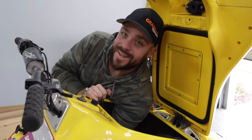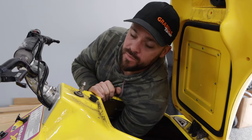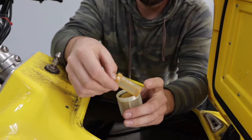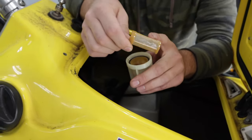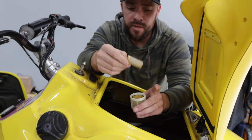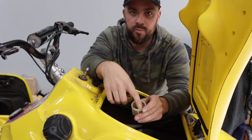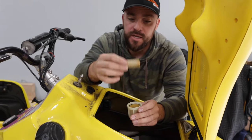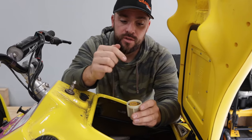We'll cover the last fuel-related maintenance item. You should be doing this every time before you put the ski away. Up front, directly underneath, there is a fuel filter. You can see there are a couple little chunks on the screen but more importantly there is a bunch of crap in the bottom of the bowl. This is a plastic filter — do not clean it with carb cleaner or acetone, it'll melt it. There's a kit on OSD that we'll link below with the filter and O-ring. At minimum replace the O-ring, especially if it's original, because a dried-out O-ring can cause air to come in and you'll be chasing problems. Clean the filter and bowl, replace the O-ring, and ideally buy the whole kit.